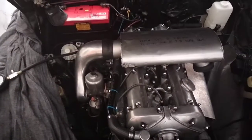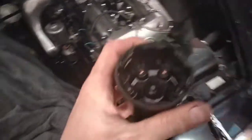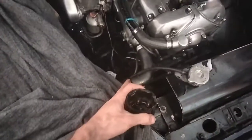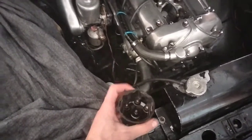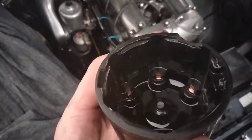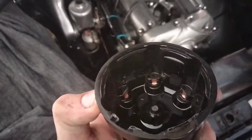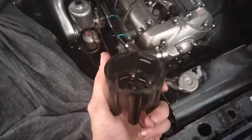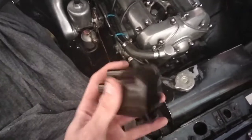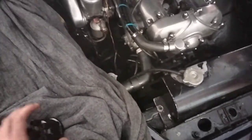That's a lesson in double checking and triple checking. I must have knocked the little spring steel tab off when I was screwing around in there, didn't see it — and see that little graphite pin in there? That's broken off. One side jumped off and I stupidly tried to grab it and hold it back on, and it snapped off. I have another one luckily — just threw that back in. Let's try again.